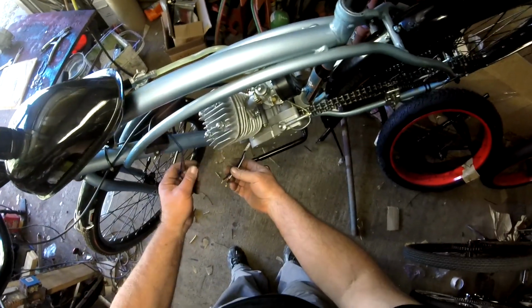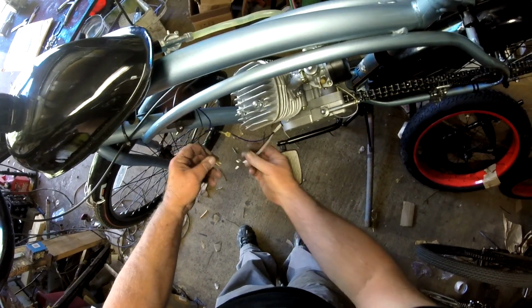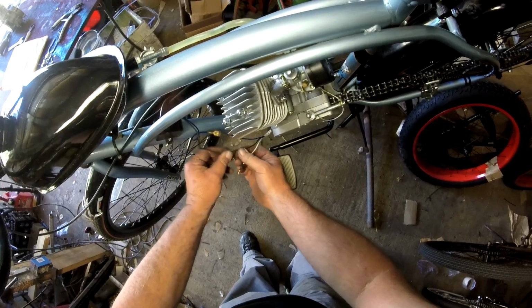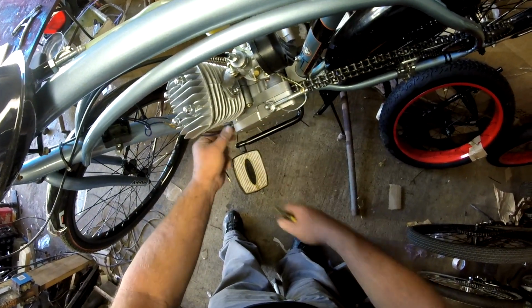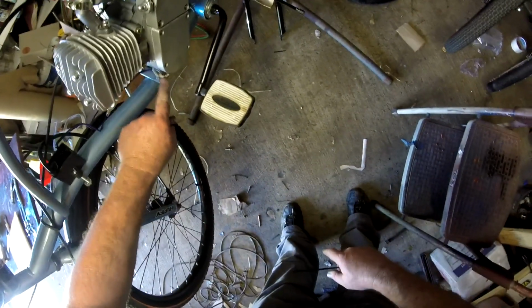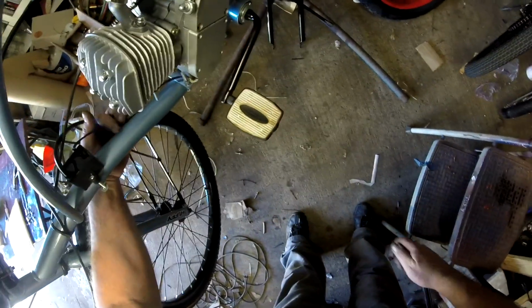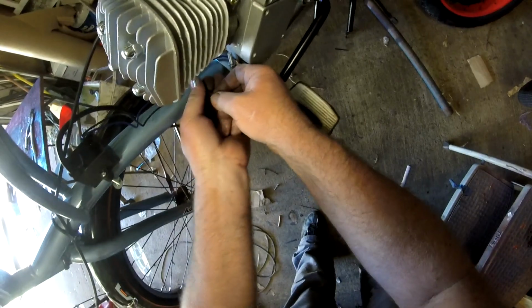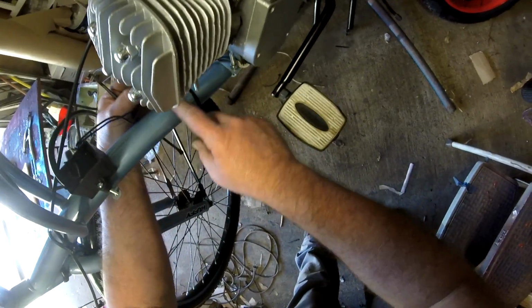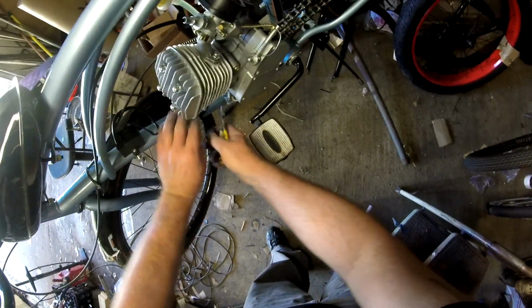Let's go ahead and connect the wires. Blue to blue. Black to black. And the white wire I'm going to just go ahead and trim. I'm going to slide back the insulative cover, cut it. What I'll do, I'll take my wires here and put them on the other side of the U-bolt to route them, keep them away from where my exhaust, the muffler, is going to be. Put a tie wrap on it. Make sure it's out of harm's way. Make sure that your insulators are covering the connectors, and trim the excess.